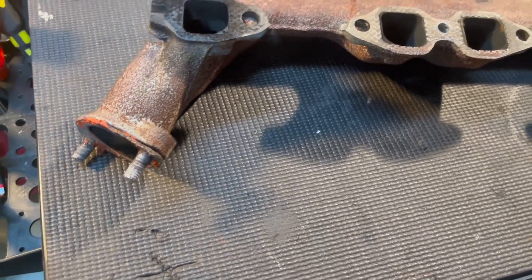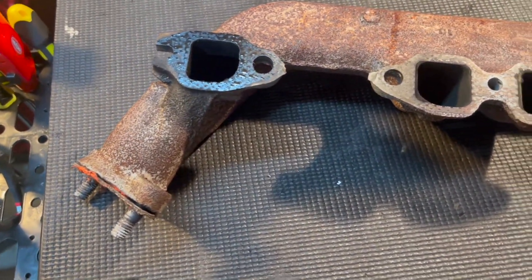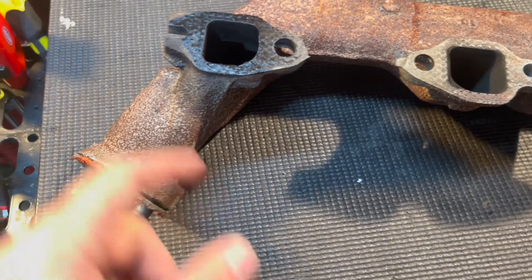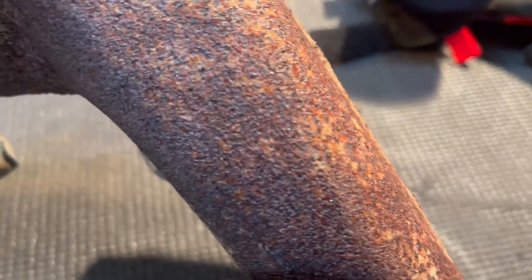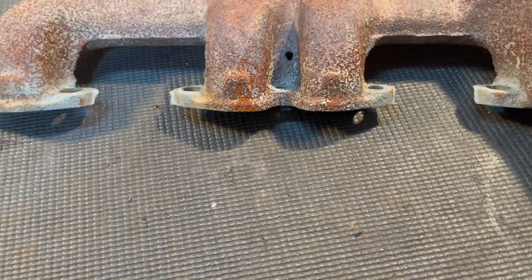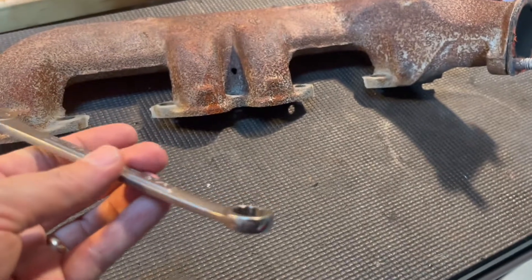Quick note: I pulled the driver's side manifold and thought I had a little exhaust tick I could hear but never could locate. Sure enough, the rear port wasn't sealing very well - the last bolt was a little bit loose. If you know anything about this, it's extremely tight to get a socket in there the way Ford made it. You're almost against the firewall with the way these are made, and that's why it's slotted - the idea is the bolt's in there loose and you use a box end wrench to do it.